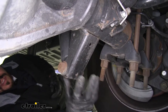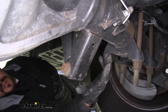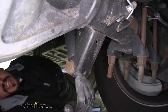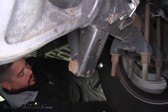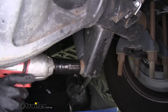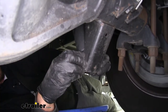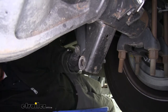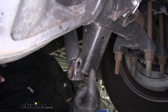Now if we move inside towards the center of the axle, on each side we're going to have our shock mount. You'll notice there are two holes in it — that's where our saddle clamps for our sway bar are going to go. In order to get the hardware in place, we're going to have to remove the lower shock bolt and move the shock out of the way. Grab a 1-1/8 wrench and socket so we can pull the bolt out and remove the nut. We'll remove the nut, the washer, and pull the bolt out. Hold on to all the hardware because we are going to be putting it back in. For now, we can just pull the shock out of the way so that we can have access to behind the shock mount, and we're going to do that on both sides.